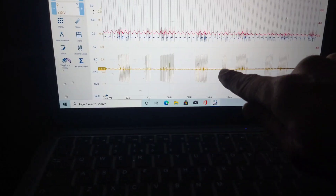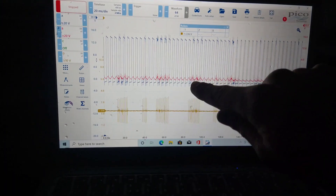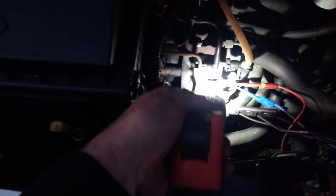I might add another channel and see if one of the injectors are causing that. Although it's not really spaced out far enough to be just one injector — could be two injectors that are failing. Or it could be this control unit — this control valve, metering valve, the suction valve, or fuel metering valve, inlet valve, right there that I'm showing the light on.